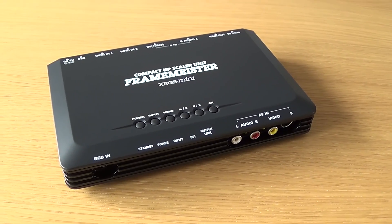Go to color settings. Set Black up to 1 and press OK. This is a setting you can't really see from a default picture, but certain solid colors — some grays — have some noise; you can see them vibrating and buzzing. That's reduced if you put Black up to 1. Don't go much higher than 1 because then the picture gets darker, and we don't want that.